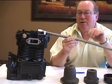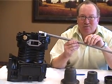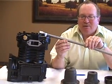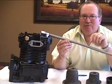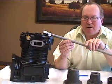You might look at the old line and say you can blow through it, but you can blow through a sixteenth of an inch too. Imagine the extra head pressure and how hot your compressor will run if you don't have a proper outlet for the air to flow down to the dryer. We recommend that the discharge line be changed each time.